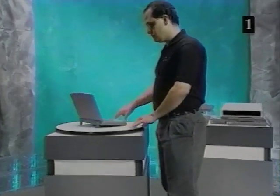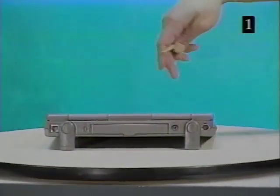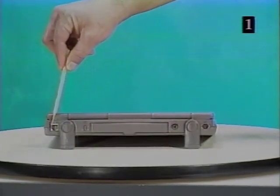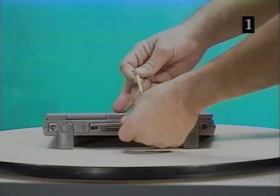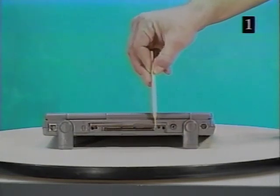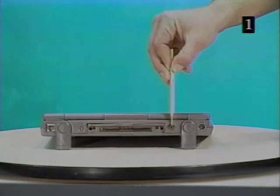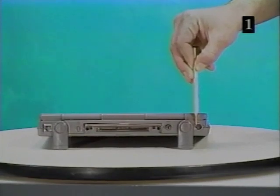The PowerBook Duo 210 and 230 computers have identical ports and connectors. The Duo 210 and 230 back panels include an internal modem port to install an optional modem or null modem card, a power on-off switch, a 152-pin main expansion connector to provide the interface between the Duo computers and expansion bars, such as the floppy adapter, Duo dock, and Duo Mini dock, a power adapter input connector, a serial port to connect printers, modems, or fax machines,